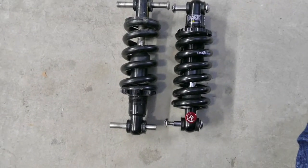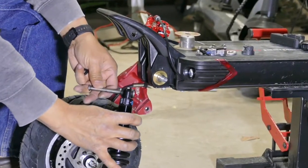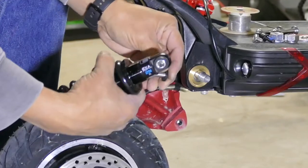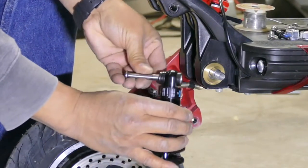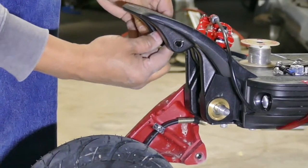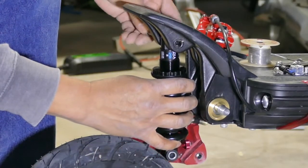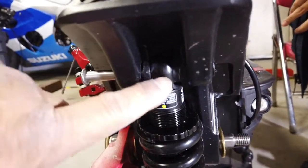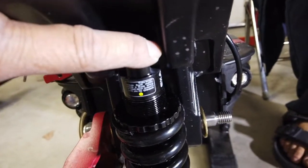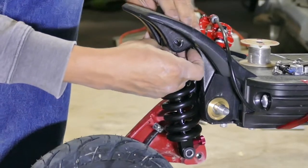There's a pin — the bolt that goes on top — and there are two thick washers that go on both sides, one on each side. That's how it's going to go in. Put the washer in, then put the shock in. Here's the upper shock bolt coming in, and there's a little gap here where the washer goes. Place that washer in here, put the other side of the washer in, and then push it through.